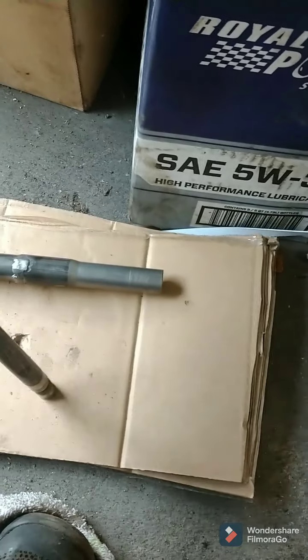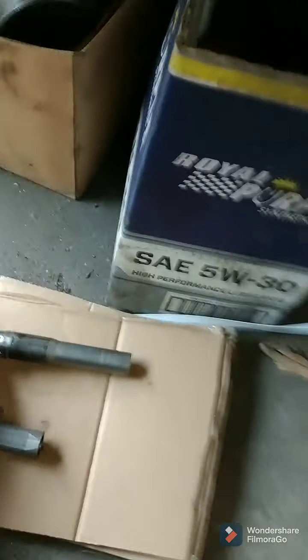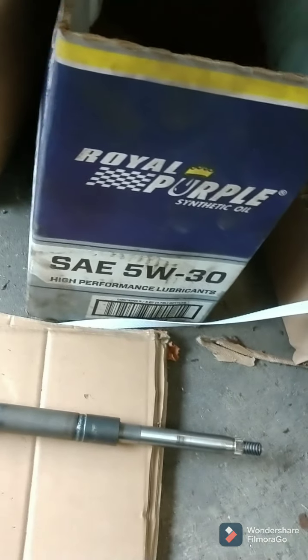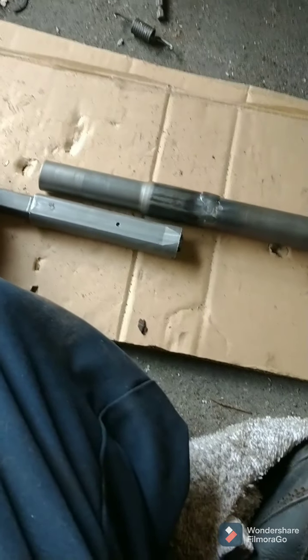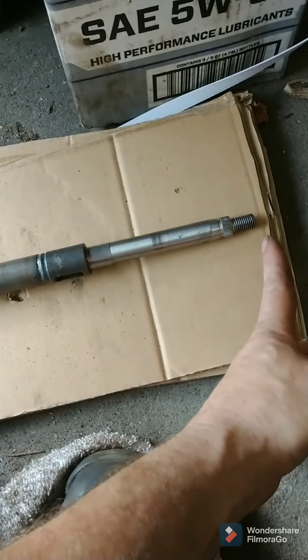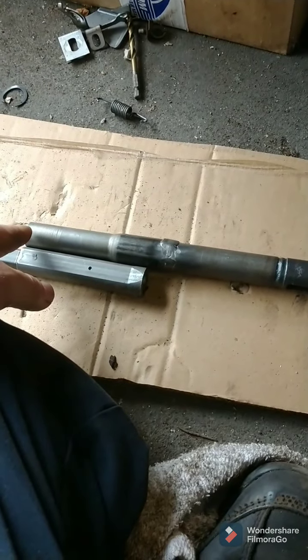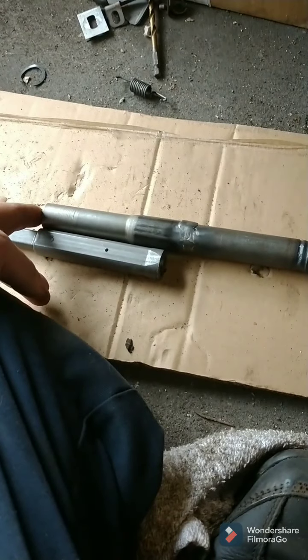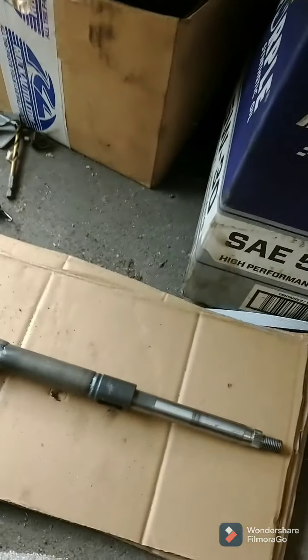And on this one, on the original Festiva shaft here, I made this shaft equal the complete length of this. Exactly this reference right here, where this piece is double D goes. This is how long the original shaft was. Okay, it's 15 and a quarter and like another 16th. So it's not even, it's like a 32nd. So 15 and I guess that would be 9/32s. I believe that's what it was.